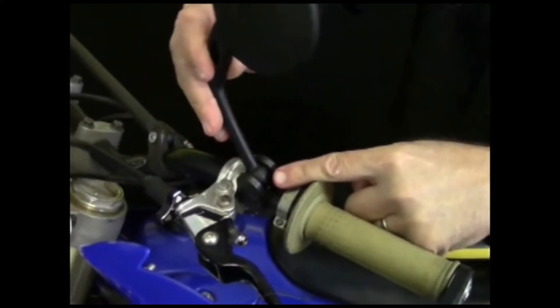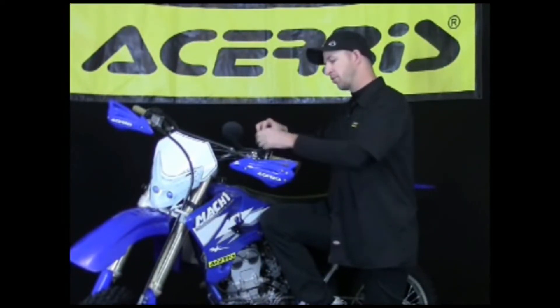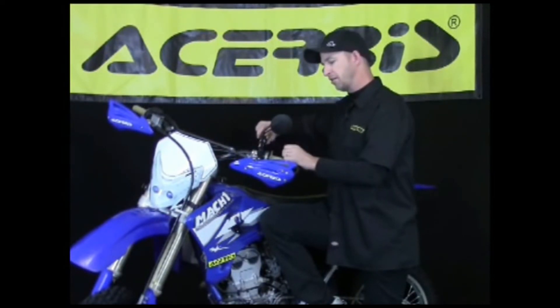For example, if you want to go off road with your dual sport bike, you move the mirror down out of the way and you can go ride in the dirt or the trees or whatever you want. But if you want to go back on the road, you loosen it back up, put it into position with the ball joint and lock it back in with the three screws and you're good to go.